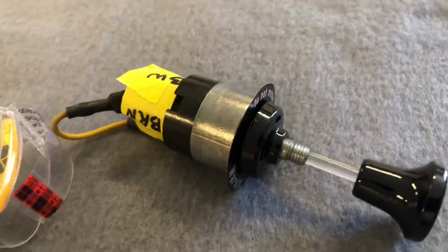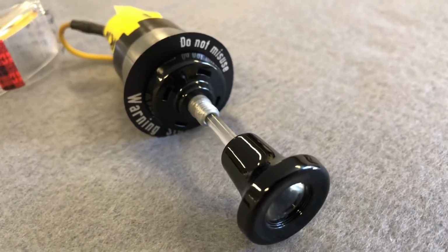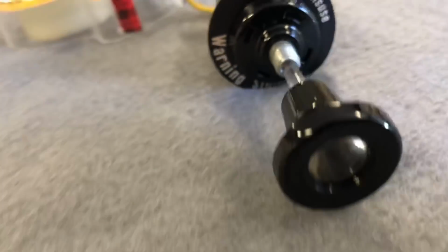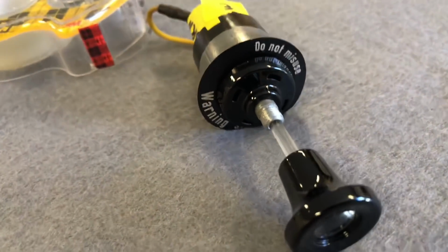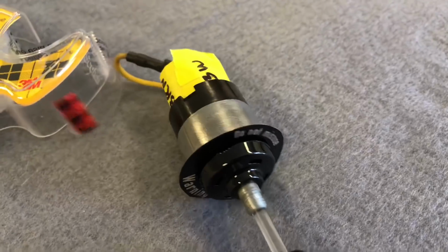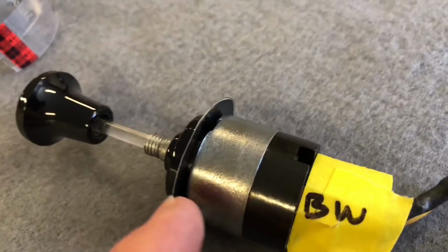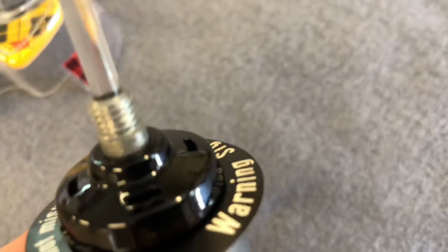This whole thing has been gone through. All the knobs and escutcheons on the dash have been shot with a base coat clear coat, and also you can see our clear lens on that has been re-clear coated to freshen that up. So it gives it a real fresh new look. And then also our original label here, you can see it's actually like a real thin metal foil on there. And so I cleaned the backside off, all the old adhesive, with a little bit of acetone, being careful not to get any on the front side there.